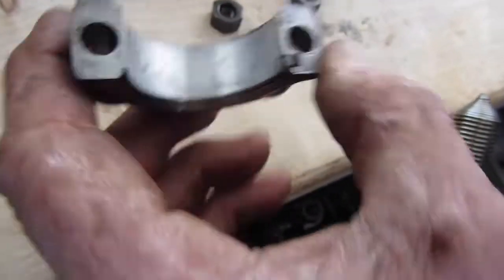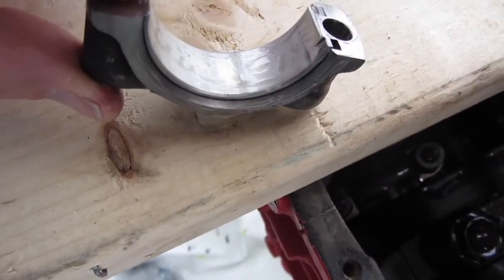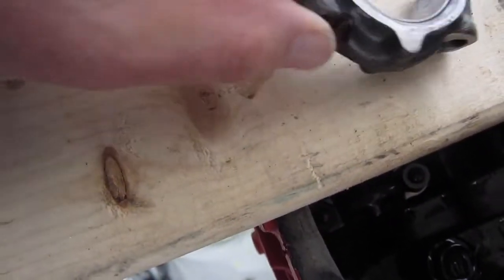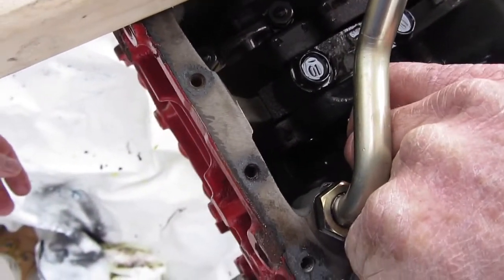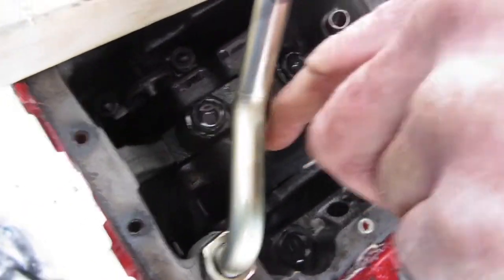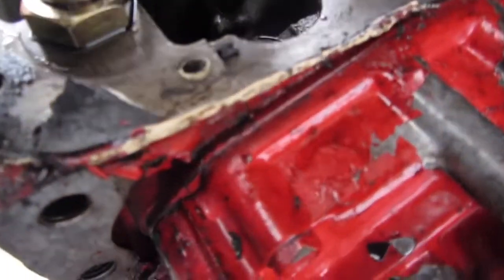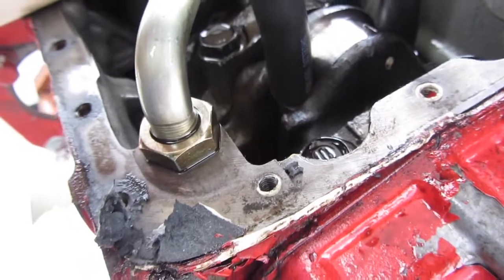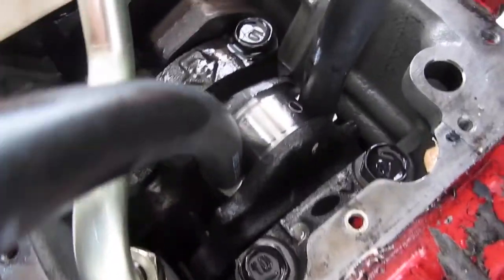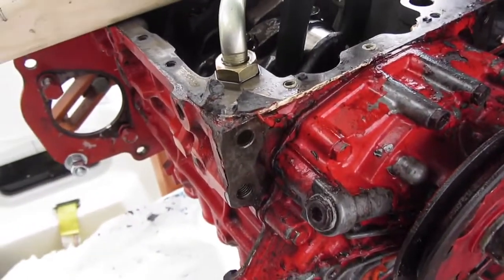So that's your Babbitt bearing right there, and they look mint — because it would have an orange tint. That's good. There's a little bit of wear right here — that's actually a notch so you can't spin a bearing; it holds it in place. The most expensive thing on this motor is the crankshaft. We've got two rubber hoses on the studs so they can't scratch the crankshaft. And how's the crankshaft look? It looks pretty smooth — it's like a hydrodynamic film where it rides on oil, not on the bearings directly. Perfect — there's no wear, no marks, nothing. We want to protect our crankshaft with the hoses until it's past the crank.